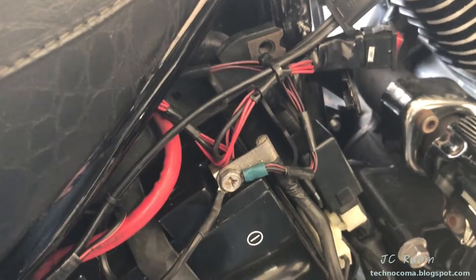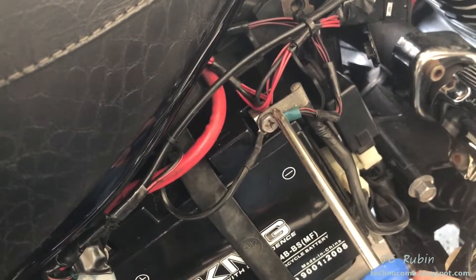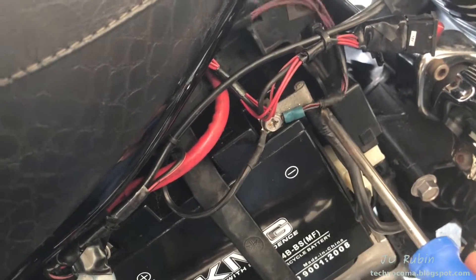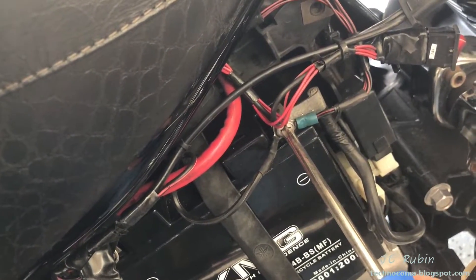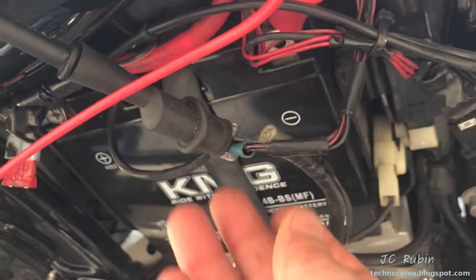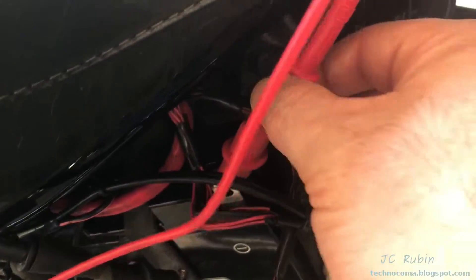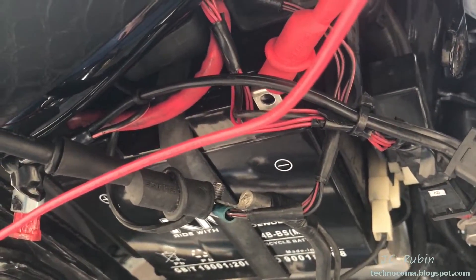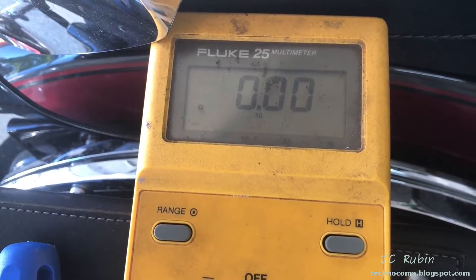Now I'm going to break the circuit. Something to be said about this on motorcycles: if you have a lot of connections connected directly to the battery and you break the circuit by severing those connections, you can see I've got my lights connected and there are two separate grounds. You can actually break the connection that's causing the problem. With the ground disconnected, I've preserved all of those connections by clamping it to the alligator clip on one side - this is the ground side disconnected from the battery. It now goes all the way through the meter and back out to the red side, which clamps to the battery. The battery is now in series with what used to be a direct connection.